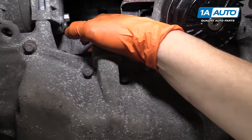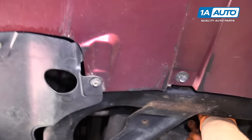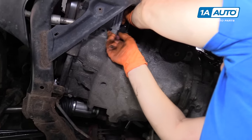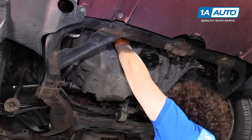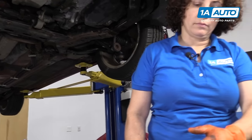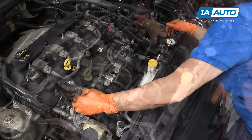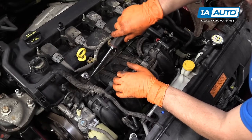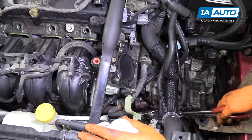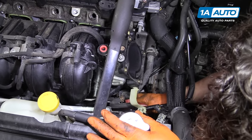There's one more bolt for the intake located down below — it's easy access actually, right there, 10 millimeter socket. I'm going to break that free. It's stuck on there pretty good, so I took a little flathead screwdriver and wiggled it free. Now I'm going to reach down below and disconnect this little harness body clip to the intake before I can pull it all the way up.